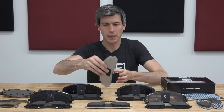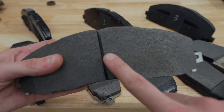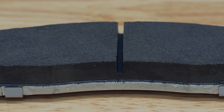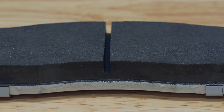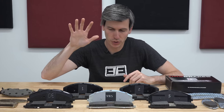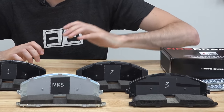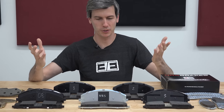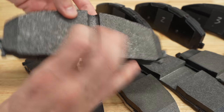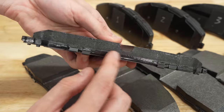You may still see gaps in the material like a slot, which functions as stress relief especially as temperatures change, and can also be useful for degassing or providing a channel for wear debris to exit, keeping the pads quieter. But the main point is the industry shifted away from mechanical attachments and switched over to adhesives. It was cheaper and it worked — or did it? Well, in many applications this remains true; OEMs will use pads with adhesives for the friction attachment, but not all of them.